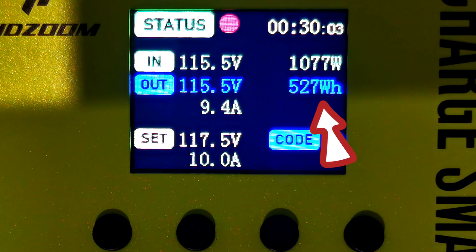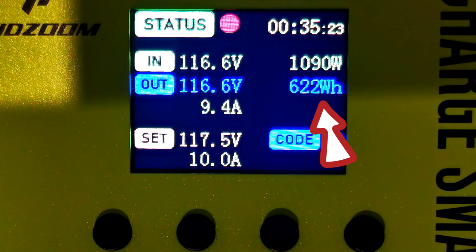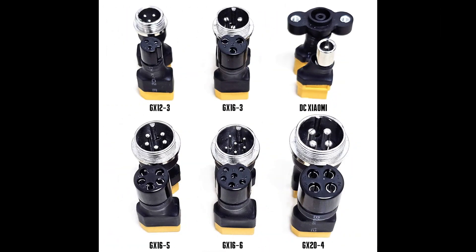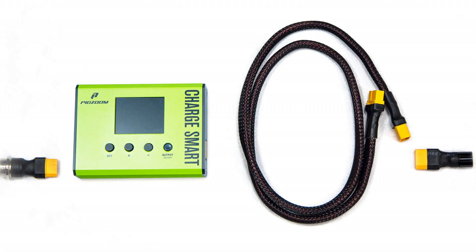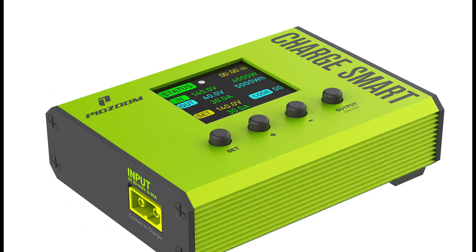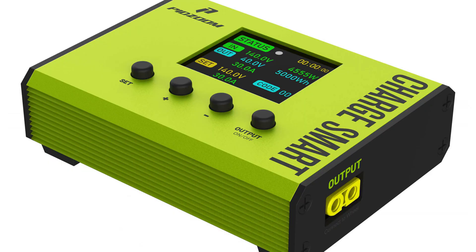Charging at 100% is not a good thing, so probably storage charge to 80% when you're not using the wheel for a period — even if you're not using it until the next day. Charge to 80%, then charge the last 20% before you leave; that's going to give you longevity of the battery and stop them from bulging and all sorts of problems. The third reason is that you can customize your charging voltage and your overcurrent protection — basically it can be a step down but it can't be a step up. Doing this achieves long battery life, safer charging, and gives you that extra safety layer.